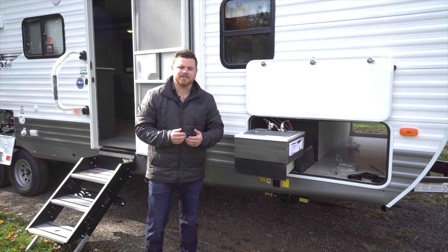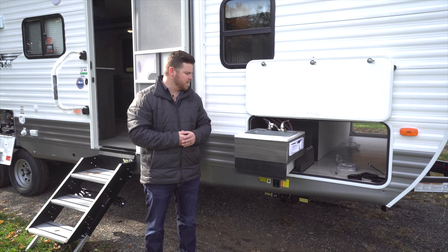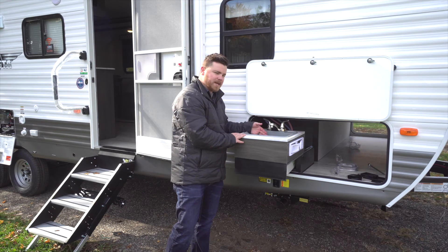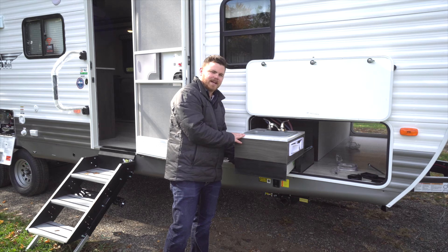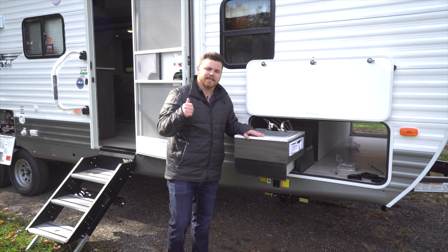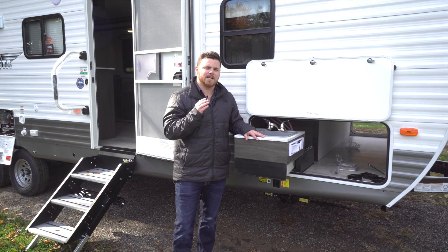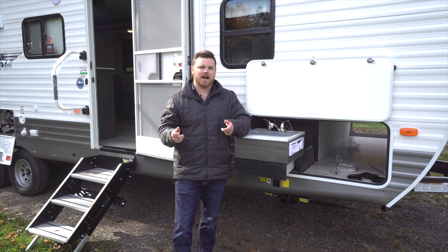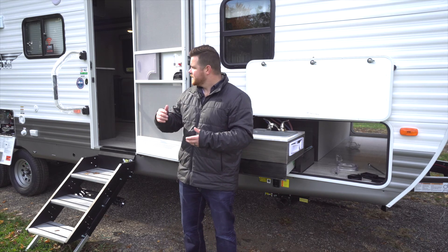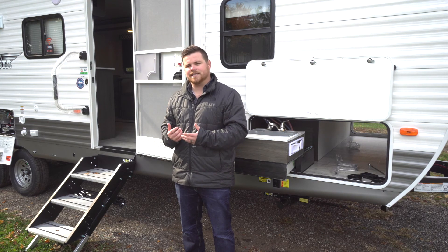Back on the exterior, there are at least two, if not three more spots to get winterized. First is the Shasta sanitized sink — hot and cold water until you see the pink running out. With this exterior tank, let it run for a couple of extra seconds. This is on every Shasta travel trailer, so make sure you don't forget it. On the off-door side, another standard feature on any Shasta trailer is an exterior shower — same thing, hot and cold, let it run until the pink antifreeze is coming through. Lastly, if you have an outside kitchen, follow the same process.